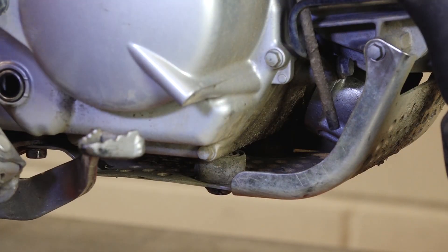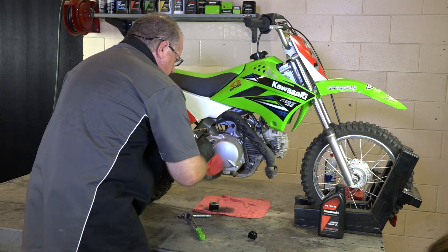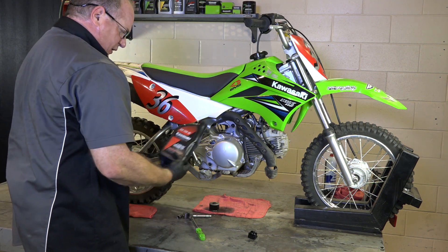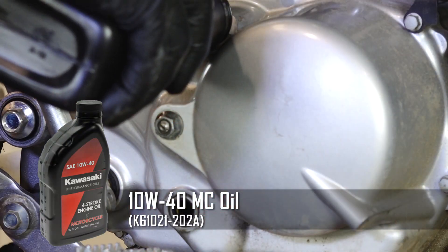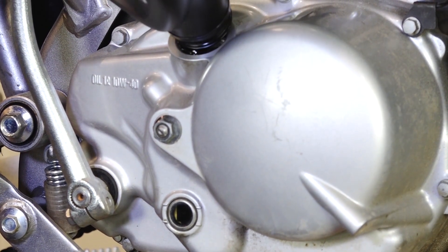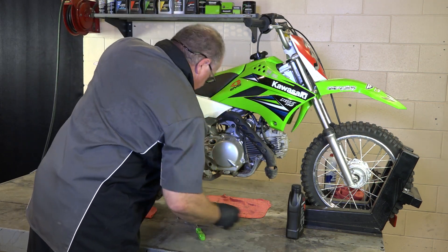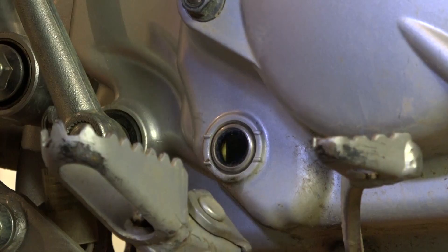I can get this last one tightened down. All that's left now is to go ahead and refill it. Now according to Kawasaki, this unit holds 1.1 quarts when you do an oil change with the filter. So we can safely go ahead and dump in a whole quart — and they also ask that you use a 10W-40, and that's what we're going to use. Of course when you're filling it up, it's going to go above the gauge over here, because to get an accurate reading, we need to put that cap back on and start it up for just a few seconds to get oil circulating and fill in that cavity where the oil filter is. Start her back up and then take a look and see where the oil level is.